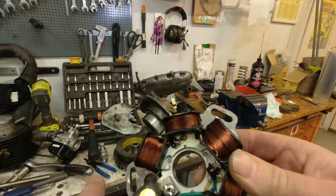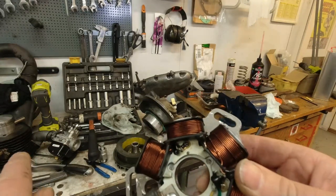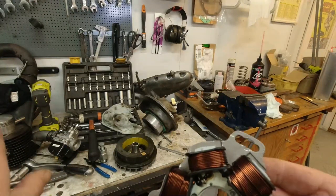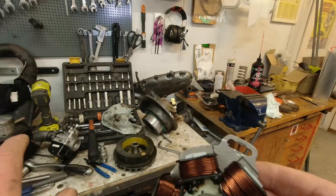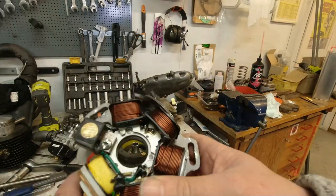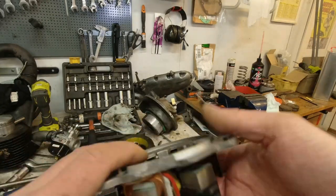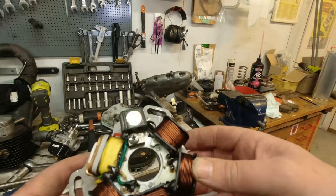The cylinder, you can see that. Can you see that? I need to buy myself some glasses. It's over there somewhere. There it is. The cylinder is a TB175 original. It's been bored out. It's got an original Mahle piston, and that is looking absolutely superb. The reason for that is he hasn't managed to get it to start. So I imagine it's electrical, but we'll try this stator first. It looks okay. The welds, the solders look okay. So we'll give this a go.